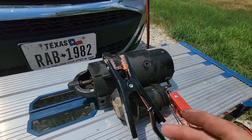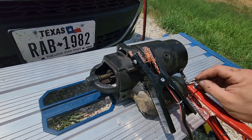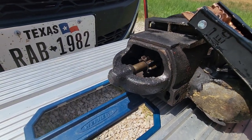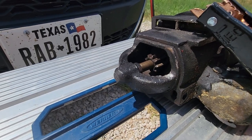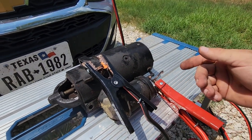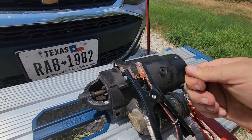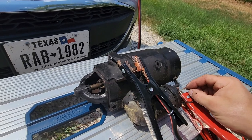It has a lot of torque so it's going to move around — I'm going to try to catch that on camera. There it goes — see, that's how a starter works. See if we can get a better shot of it as it kicks out. So when you turn the ignition key on, that sends power here — it activates your ignition, your fuel injection, your radio. And then when you turn the key to start, that input sends power from this line to here, just like this — that's what starts it.